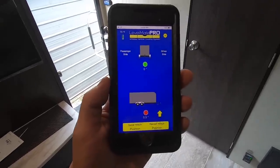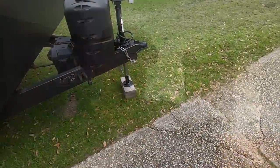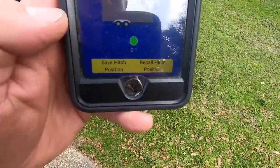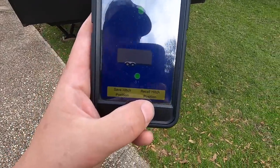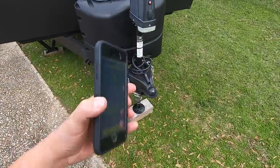So we've got it installed. The next step is once we get to the next campsite — we're going to Destin for a training class for a week, setting up at Camp Gulf over in Sandestin — that'll be the first time I use it and I'll show you the app getting the camper leveled. Also, when hooking up, you can use the Save Hitch Position feature — raise the tongue to where it clears the ball, hit Save Hitch Position, and then you can look at your phone to know where you need to be to back up without problems. It also has Recall Hitch Position so once you're level and want to hook the truck back up, you hit recall and it tells you where to set the tongue.